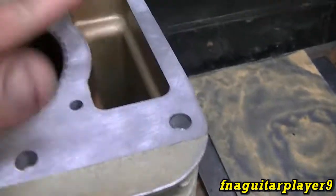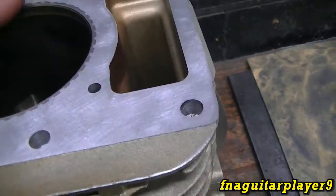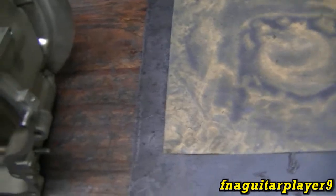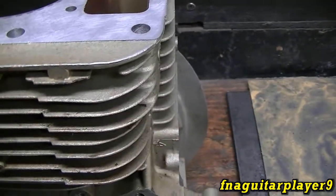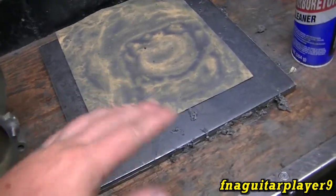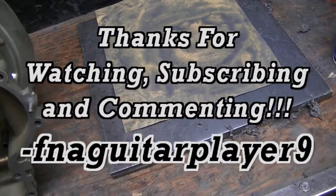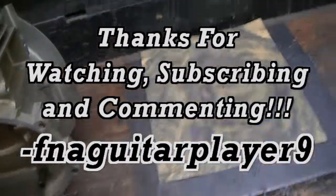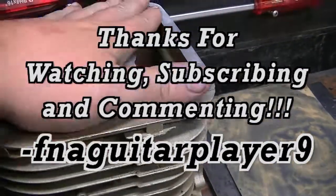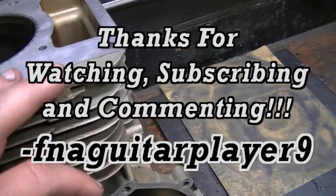There are a lot of different methods for doing this, and this is the cheapest and easiest way to do it yourself. The only things I had to buy were a steel block and some sandpaper. You want at least half-inch thick steel, and bigger if you can find larger sheets of sandpaper. It turned out perfect, so we should get a perfect seal. This is the same method as using a granite surfacing plate — I'm just using steel because it's a fraction of the cost and getting pretty good results. If you have any questions about surfacing plates or surfacing parts, leave a comment below and I'll get back to you.